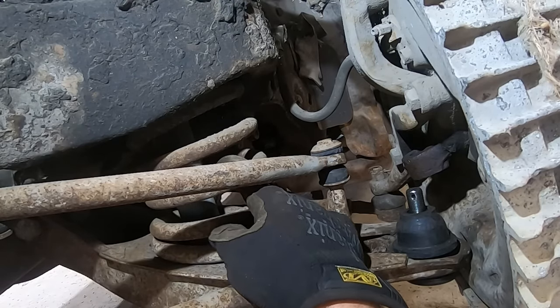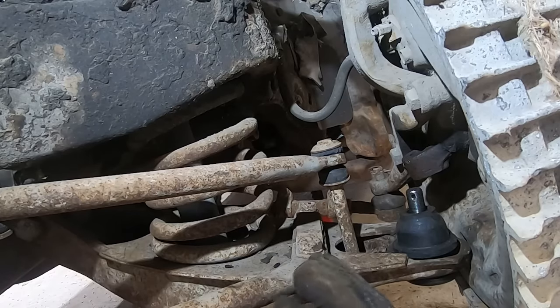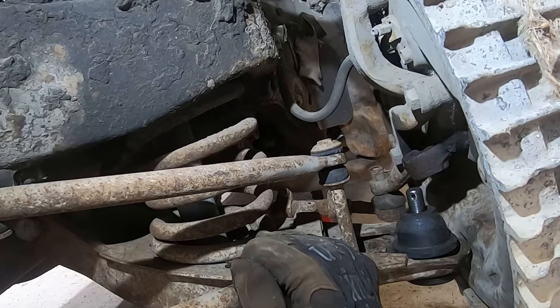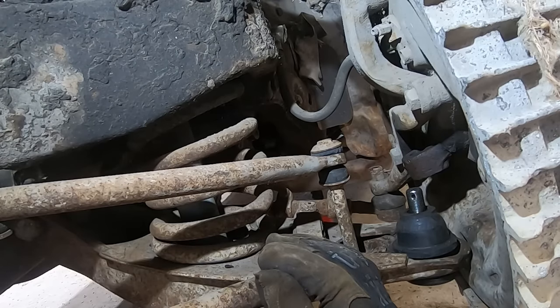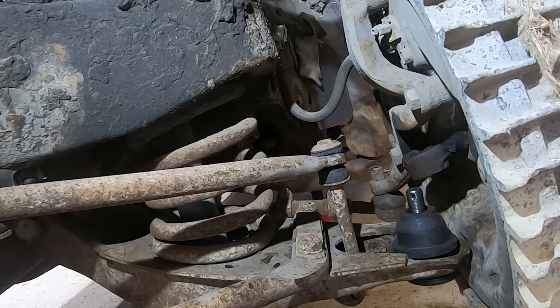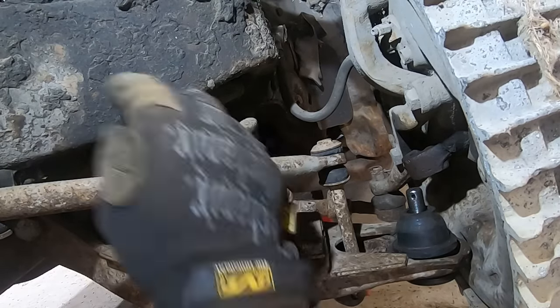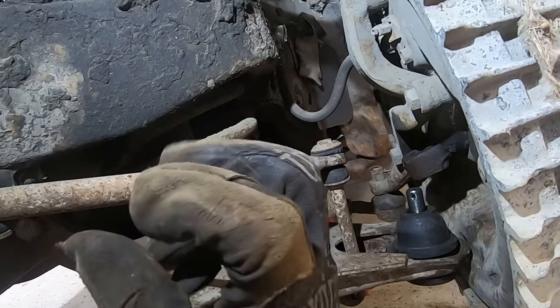And we still might have to get creative and tie things together, you know, because the spring here is doing its job. So I don't even know if I do have a spring compressor, but it seems like it never works and it's scary and there just isn't room for it. So this is a good way to die. A good thing to have was a chunk of ready rod. Pull the shock out here and put a chunk of ready rod all the way through the lower control arm up to the frame rail and then just sucker down.